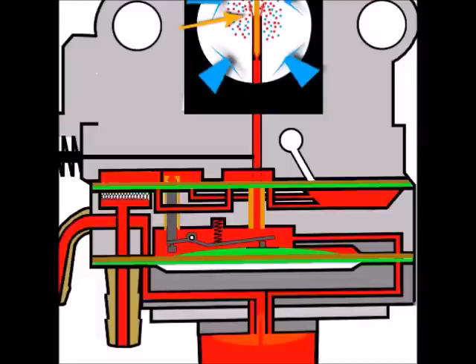It's the air rushing past the end of the jet that draws the fuel out, but that isn't the only pressure helping the fuel come out of the main jet — it actually gets some help from this diaphragm here. This is the fuel pump diaphragm, and it spans right across the width of the carburetor, though the fuel pump part is this area here.